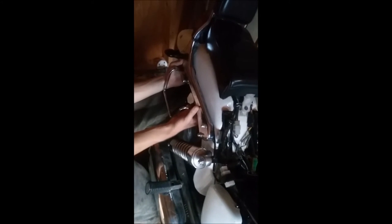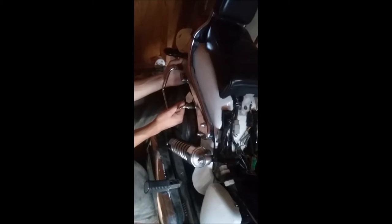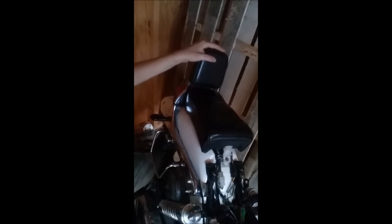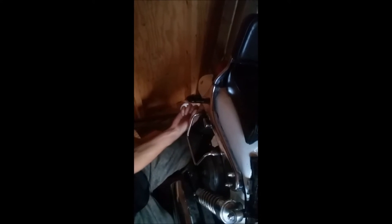When mounting a new kit, always get washers — if you don't use them and you tighten the bolts down, you're going to crack your paint and potentially crack the fender, especially if it's fiberglass rather than metal. Once you get all these bolts taken off — the two here and the two on the back — this assembly will lift up. You don't necessarily have to take the backrest assembly off to replace the directionals, but you can if it makes it easier.